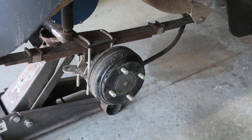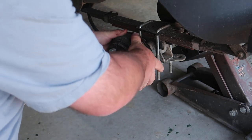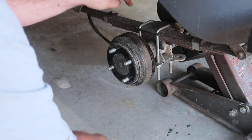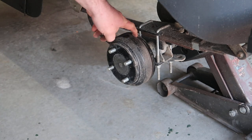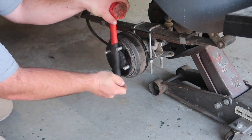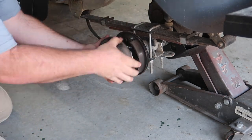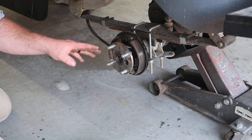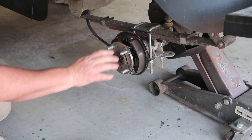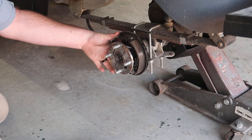It's wanting to turn. Let's check out the driver's side - that's our problem right there guys. The brakes in here are sticking on this one; it doesn't want to come off, it doesn't want to turn. So we have an issue on this right side. Let's try to get our rubber mallet and beat this drum off and see if we can inspect the problem. See, it is turning but it's tight. That's off now. Let's see if it'll turn with the hub itself off - yeah, it's turning fine.